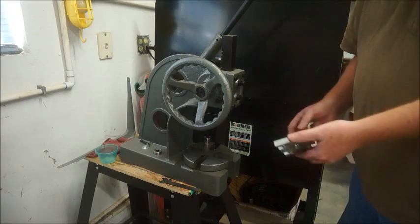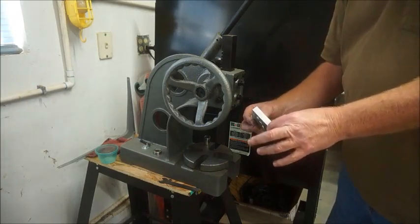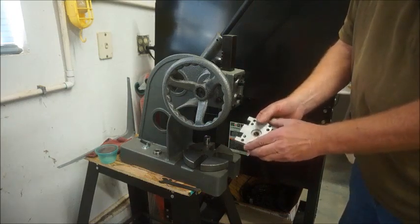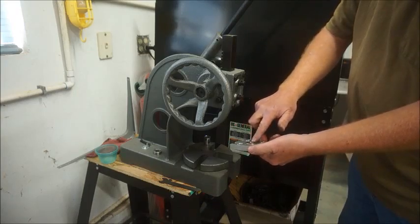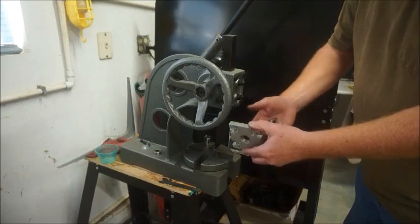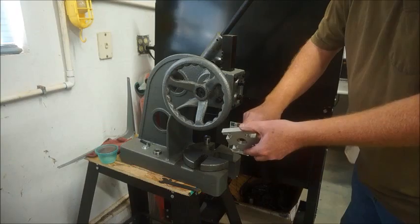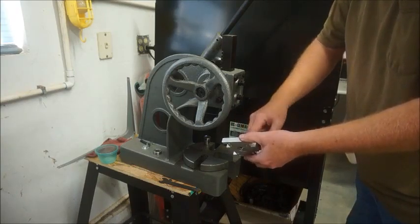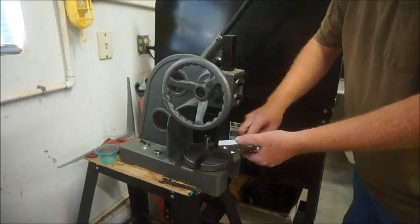There's been some discussion about the bearings on the Prodigy machine. I've taken the end cap off already, and this is the main shaft bearing — this is a 104. As you can see, it spins really good, but if you were spinning it and you were here, you can feel little catches when you move, once in a while. That means this bearing has been used very much, so we don't want to put this back in and cause another problem.